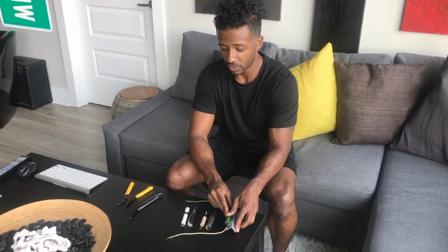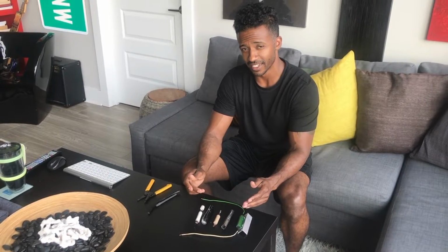I went ahead and replaced both of my fans and both of my resistors. My low-speed resistor on the passenger side continuously failed, and that's why I decided to go to an aftermarket resistor. I think that the most cost-effective resolve for this type of scenario would be buy an aftermarket fan and resistor, and if the resistor goes out, just go on Amazon and buy yourself a resistor for $5 and install it. It's not very difficult to do. It's a little hard to do upside down in the dark, but it's a very easy job, and in the end, you'll save yourself a couple of dollars and keep your car rolling down the road.